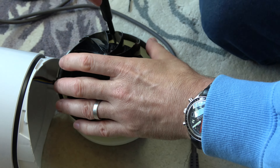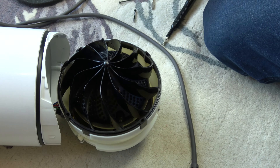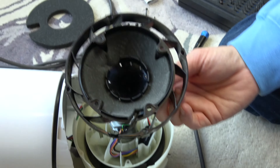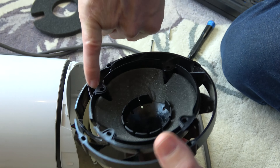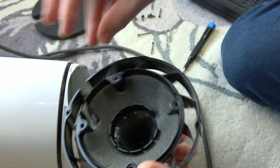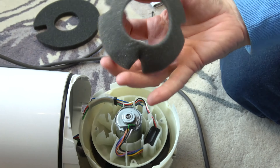This here is your motor. One of the filters is simply at the bottom here — if you look deep in you'll see there's a filter. These are clean on this fan because I've already cleaned them, but you'll find dust on yours. You can give it a vacuum, then put it in some warm water for a good clean. Be gentle — it's only foam. Make sure it's fully dry before you put it back; you can use a hair dryer or leave it in the sun.